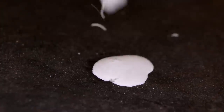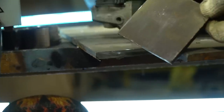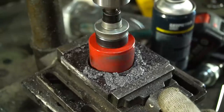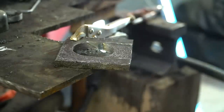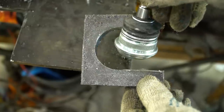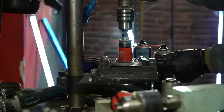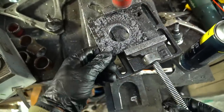Now we need to cut out the control arm adjustment mechanism from the steel plate. This detail will be an organic unit with the control arm — a ball socket will move along it, changing the wheel inclination. The ball socket platform will also be cut out of the 10 millimeter plate. Its bore diameter is 39.5 millimeters. I took a crown for 38 millimeters, which makes a hole of 39 millimeters on my drilling machine. I'll bring the hole to the desired diameter manually using a pencil grinder.